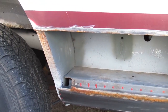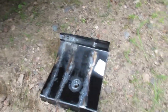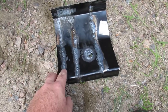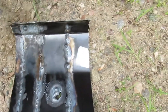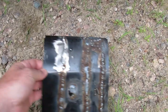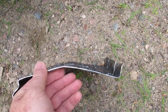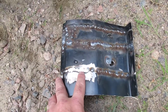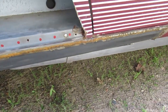I'm going to put in the bigger patch here. To dial in the welder, I took slices of the rocker panel I wasn't going to use and kept trying different settings until I could get some penetration. I did a bunch of different things — playing around, making a blob to take the burn-through. With 18-gauge or 1.2mm material, it's actually pretty reasonable to weld. My goal was to dial it in to get a flush bead, but I couldn't quite achieve that. I found it's easy enough to grind off, so I just made lumpy welds and ground them down.